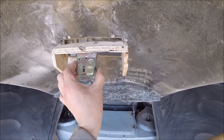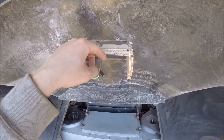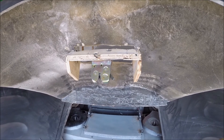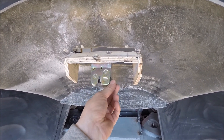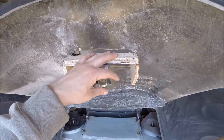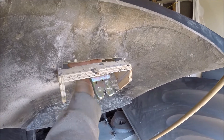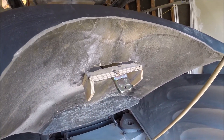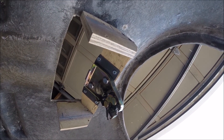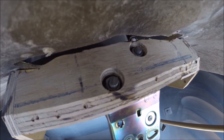This cancel switch is what's actually used to open up the latch and allow it to open. On my Subaru, this cancel switch was up — I had all my stereo equipment in the back of the car and I was working on the cable for the striker, and my trunk was sealed shut. The only way I could get in was to cut a hole in my trunk to hit the popper. That porthole here lets you get in and work on the pieces inside. I've got a nice metal plate on there that's screwed in, which will get fiberglassed over, and there are some little nuts welded onto the back to allow it to fasten in.